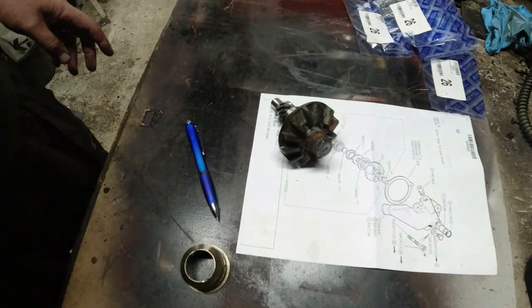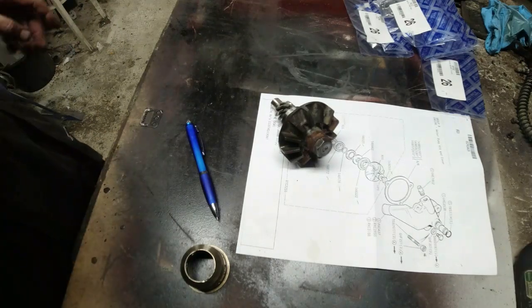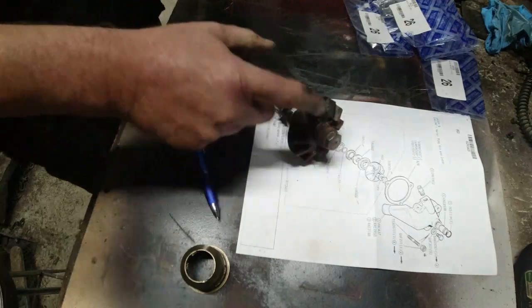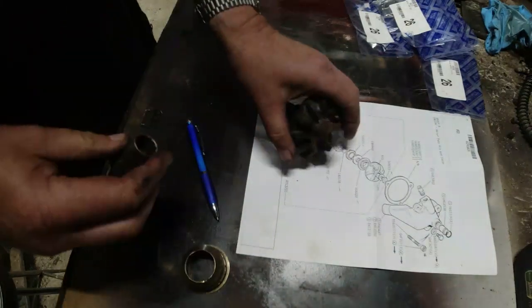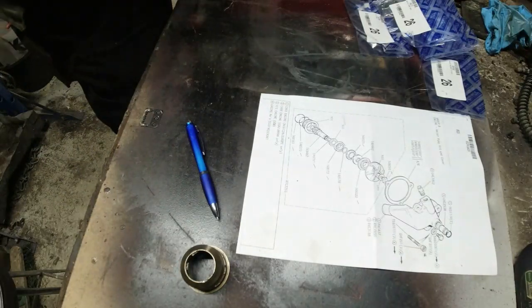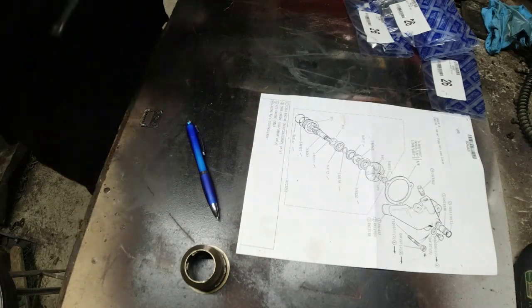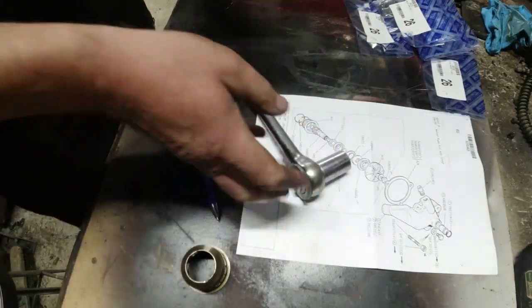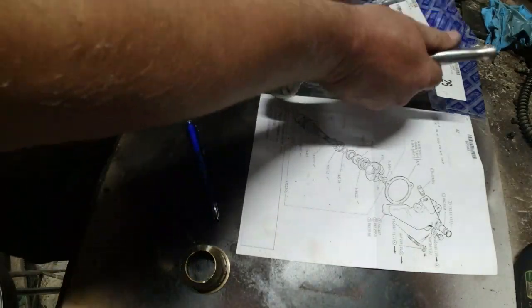First and foremost we've got the nut on the top to undo. Bear in mind that nut is left-hand threaded — righty-lucy. It's a three-quarter socket, so when I go righty-lucy it should come off. Sometimes they're a little bit on the tight side, sometimes they come off and behave themselves.